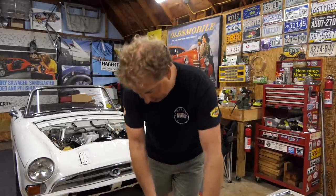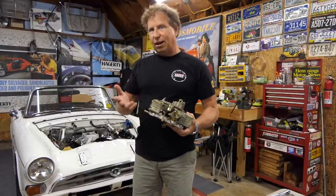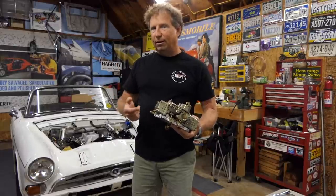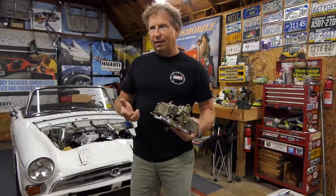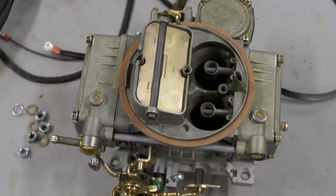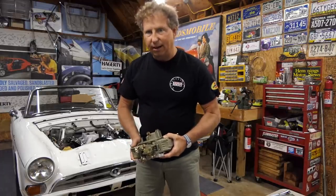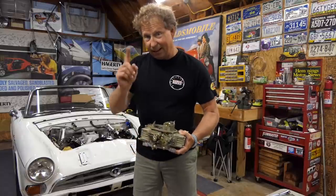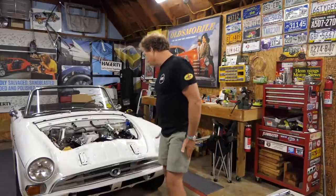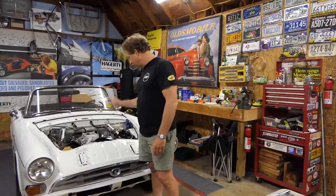The last piece of this, what I've realized as I'm moving forward, is I still have the stock fuel pump, and the stock lines are connected. When I get this distributor in, and assuming the water lines and all that stuff are set, if I want to fire it on the carburetor, this 650 CFM that we also got from Holley to run it on the test stand up in Michigan, I can do that super easy. So, executive decision made: we are going to fire it with that carburetor first, make sure the timing is set, make sure it runs, make sure there are no issues.